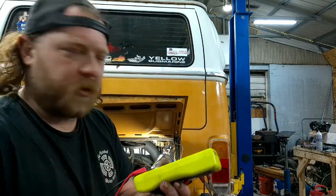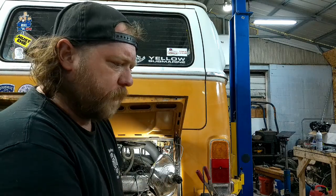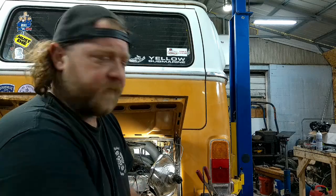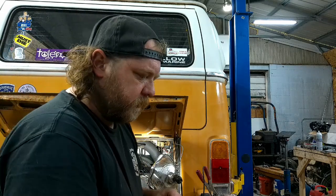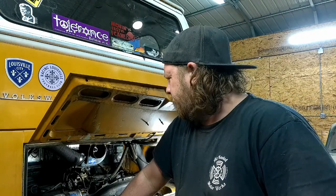If you got a 3 ohm coil or higher, it'll work. So let me assemble this thing, throw this in there, throw the electronics in, and hopefully not have to fear burning up a coil, because a lot of times people complain about the electronics burning them up. They assume they have what they have, because that's a nice Bosch coil. Bosch coils mean best. Anyway, Bosch means best apparently, but they never check them, so they'll burn up electronics, and it's the most terrible thing ever. Stick to points. Points are a little more forgiving when you don't know what you're doing, to a certain extent.